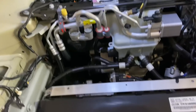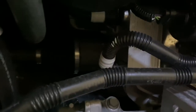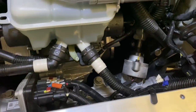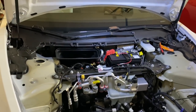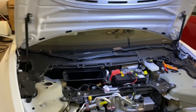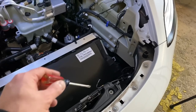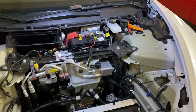Here's a good look at your area where the frunk is removed. You can see you've got your motor down there — this is a dual motor car, so it's got a motor up front, with the built-in differential and axles going into it. So just by removing this whole area, we're a quarter of the way done. We really just need to replace the struts, put the new latch equipment in with the motor, route the emergency pull cable out, then run everything up here, connect it to the battery, plug everything in, put it back together, and we're done.